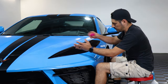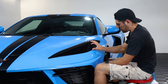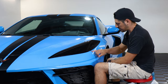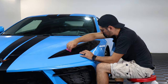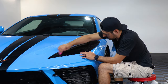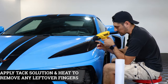Now that this section is secured we can focus on the middle section of the headlight. To remove any small fingers, apply tack solution. You may need to apply heat to minimize the fingers and make them smaller. Once finished, use your microfiber towel to make sure there's no solution behind the film and to absorb any remaining solution. Apply tack solution, tack down the film, then focus on breaking down the fingers to make them easier to tack down. Apply heat with the heat gun on the fingers to help shrink and then tack them down.